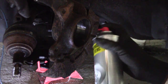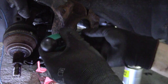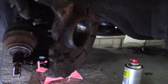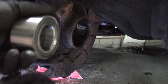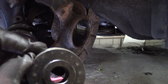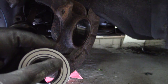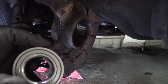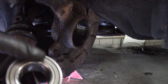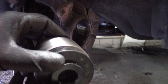If it is a bit rusty, just use a scotch brite pad or something like that, and normally you use an old screwdriver. You need to use a disc that's the same diameter as the bearing — at least as close as possible — because you don't want to only push on the inner race or the center where the sealer is. You want to push on the outer race with the disc. As you can see, this one is just fine.